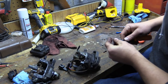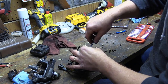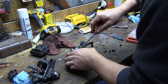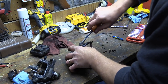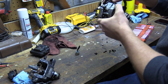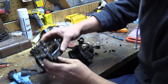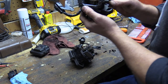This piece I'm bolting in right now — Caleb, it is the ignition module. That's what does the control of the ignition coil based on signals that the engine computer gives it. Based on the symptoms this thing had, how many people would have suggested plugs, wires, cap and rotor? That would not have fixed it. It is an odd fault, and it really wasn't causing miss-triggering on the primary side — not from what I saw. I think that pickup coil winding was still in decent enough shape to produce a signal.